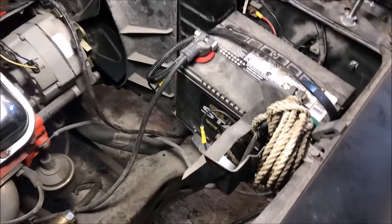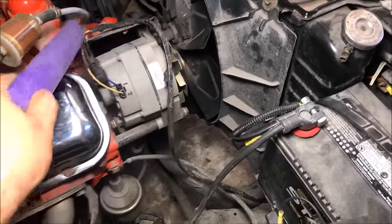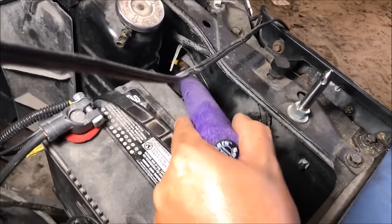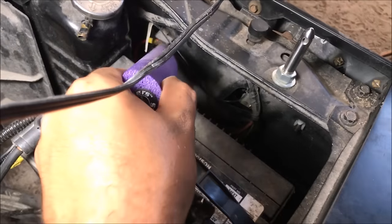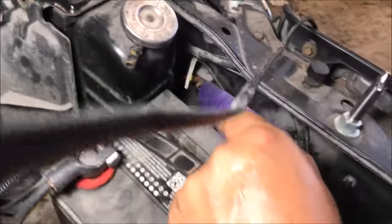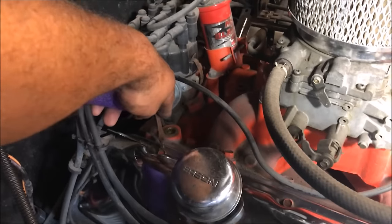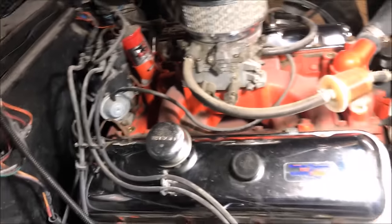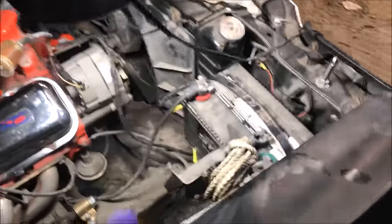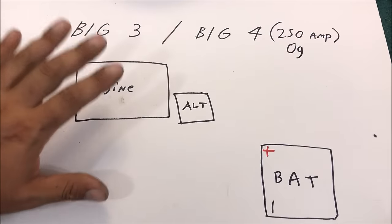So this is factory wiring - I redid all the wire, 100 percent original. We have our negative to the battery going straight to the block - that's factory style. Our charging wire loops over, factory style, comes to a junction block. We've got another red coming off the battery. We're going to add a junction block for our new bigger power wire because we don't want to mess with that one, and it's too small. As far as chassis grounds, it's got two grounding straps, one on each side going to the firewall - probably number 10 wires.